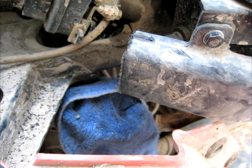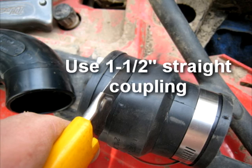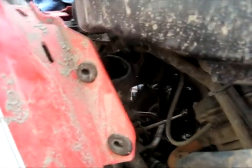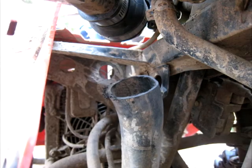I had to make an adjustment to the length of the rubber coupling so that the Street 90 would fit into it properly. Just as a note, the Street 90 has one side that's the same size as the pipe so it fits inside the rubber coupling; the other side is expanded so it'll fit on the outside of a pipe. Again, please disregard that we're using two-inch pipe in those photos — we're actually using inch and a half.